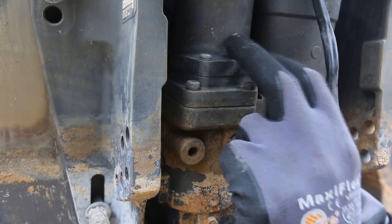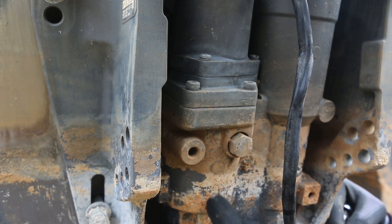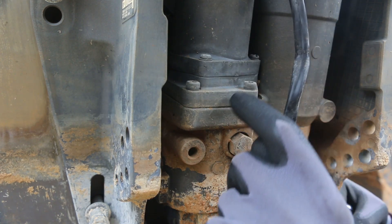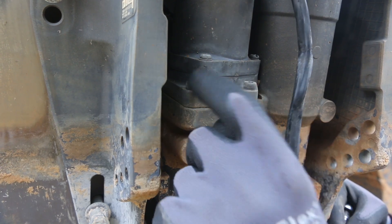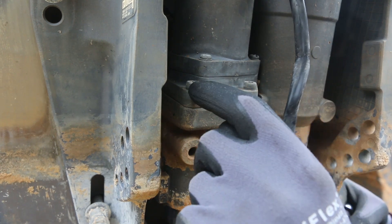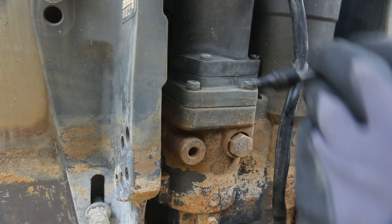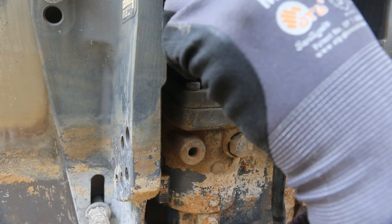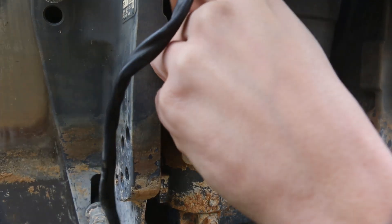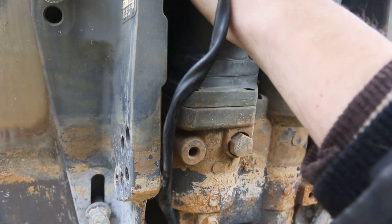Let's get over here and see what we need to do to pull this motor out, replace it, and get the new one hooked up. This is the power tilt and trim motor — it has a hydraulic pump down here and a cylinder here. We need to remove this assembly, which on this model includes a second little plate. We're going to be loosening these four 5-millimeter hex bolts, then break it loose — it has just a little o-ring seal — and pop it up out.